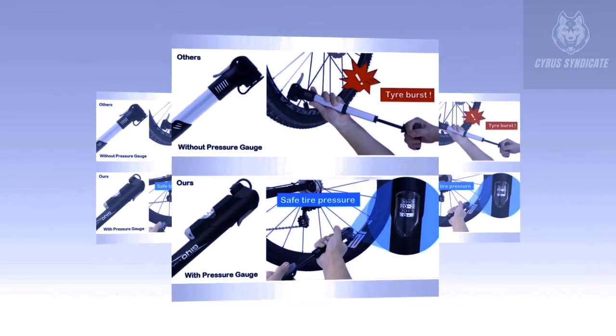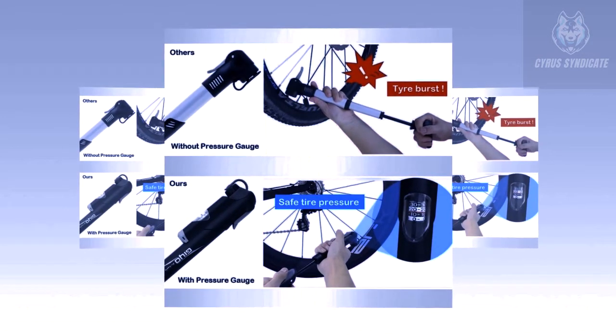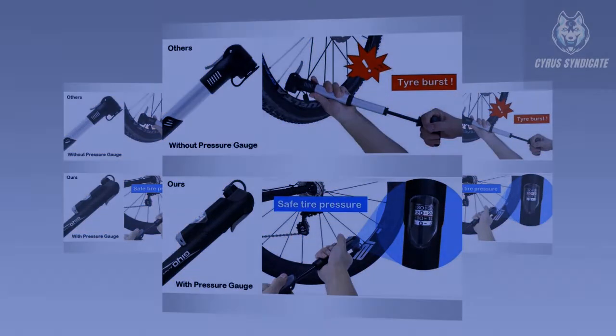Pull back the grey lever until the pump is tightened securely onto the tire. Inflate the tire to the recommended pressure, then remove the pump from the tire valve and refit the valve cap.